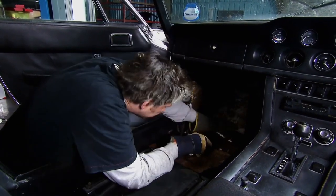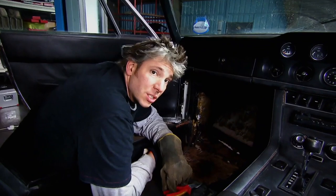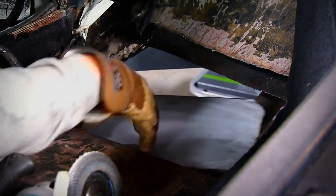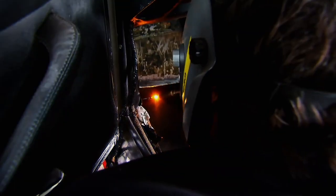So I just need to get rid of all this rust — there are tonnes more underneath there. I'm going to cut all of that out and then start putting metal back in. Now that's looking pretty good. If it fits or it touches, that's the main thing. After a few more adjustments with my grinder to ensure a perfect fit, I can tack and then seam weld the panel into place.